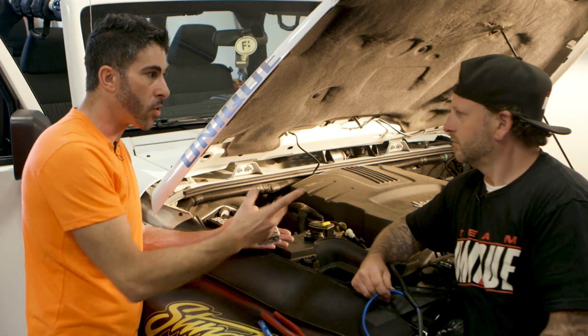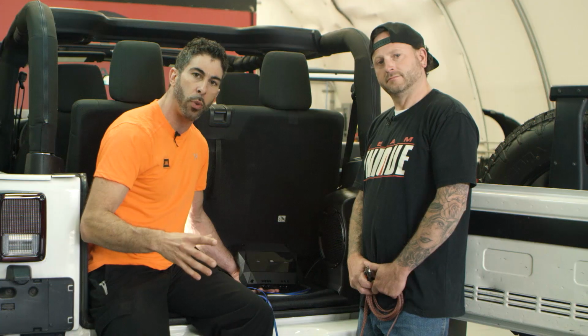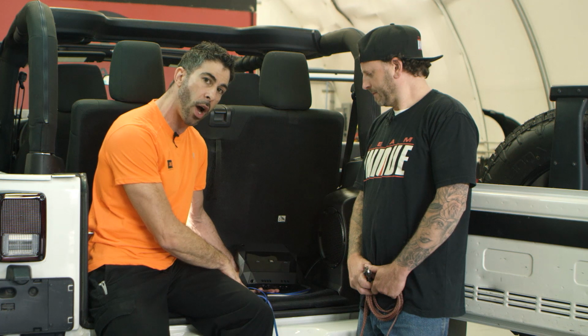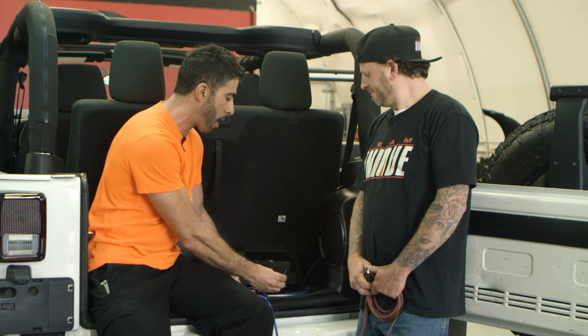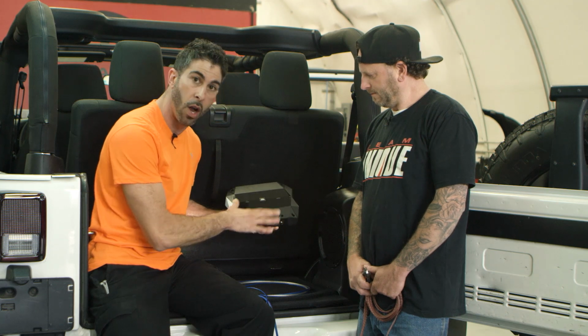So I'll tell you what, why don't you go over here, I'll climb underneath there and give you a little knock, and we'll get the hole done on the firewall. Sounds good. So we've run one run of 8-gauge wire from the battery all the way back here. I've got my ground wire right here, which is run and it's grounded solidly. Reme already went ahead and took care of that. I've got my remote turn-on wire right here, and all we're going to do is kind of screw those right into the terminals on the amplifier.